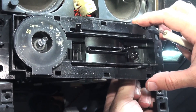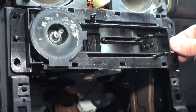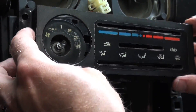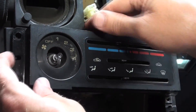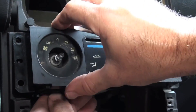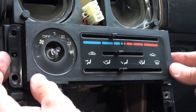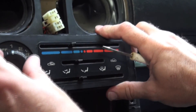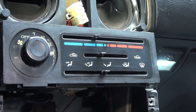For our intents and purposes though, we're going to leave those in. We'll carefully turn that back to the lock position. Now we'll pretend we have a brand new one of these, reattach and get it lined up, line these up into the center to make it a bit easier, and press-fit this back on. If you are ordering one of these from Mazda, order those two bulbs at the same time. So that goes on like so. We'll reinsert the knob for the heater controls, and we will take four screws.